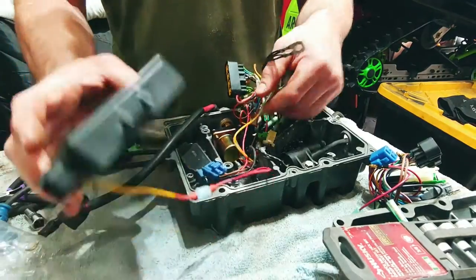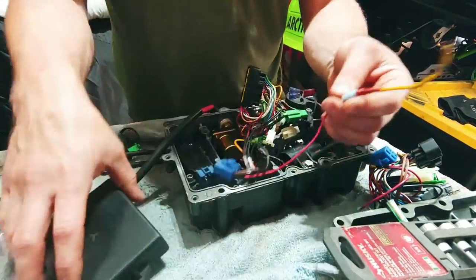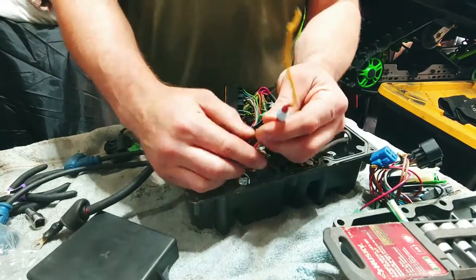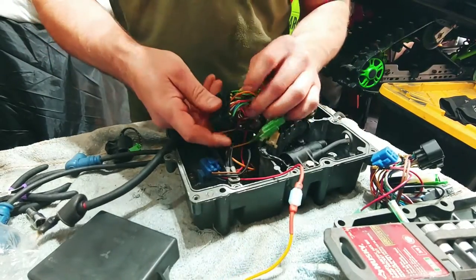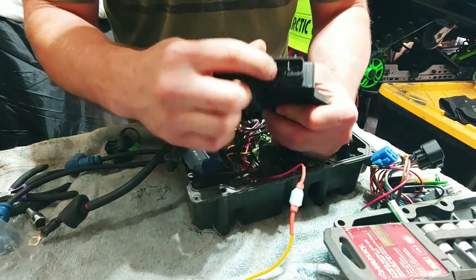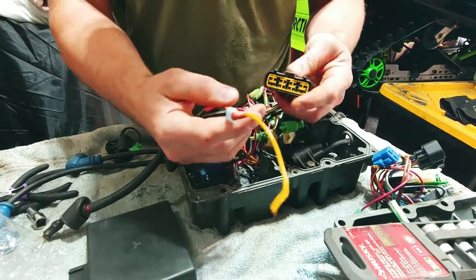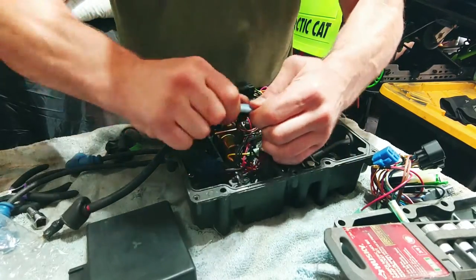Where'd it go? Okay, so this piece right here, it came off now. But I tried fixing this by soldering it to that piece. Didn't work. The reason I had to do that is because this red wire pulled, well, first and foremost, one of the pins broke off on the inside of this section here. There's supposed to be four pins, there's only three. And the pin that broke off, coincidentally enough, was the 12-volt supply pin